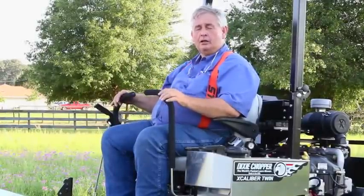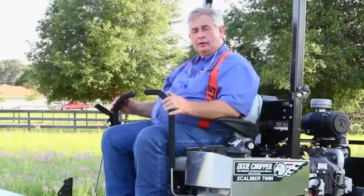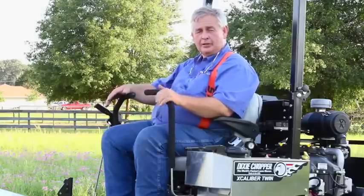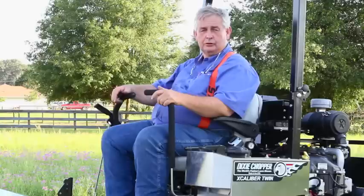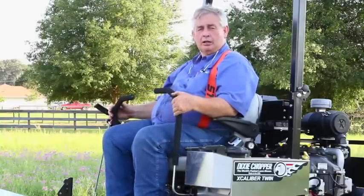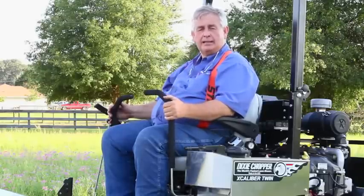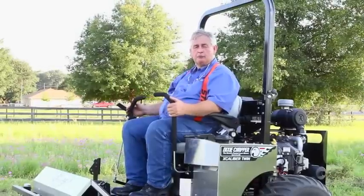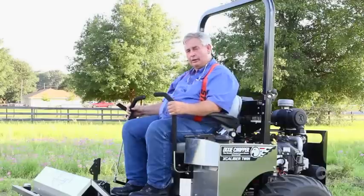At the time you lock the rear wheel down, you'll probably leave a divot hole. If you have a zero turn and you've been mowing with it, and somebody sold you this mower and just told you to go out in the middle of the yard and start — you'll learn how to mow it — you're starting to find these little divot holes in your yard everywhere you turn around. The reason for that is on your inside handle, you're not pulling it back. So therefore the inside turn, your inside wheel is not reversing. Your right one is going forward, your left one is not — it's just locking. So therefore it's like you're planting your heel and spinning around; you're just making a hole in your yard.